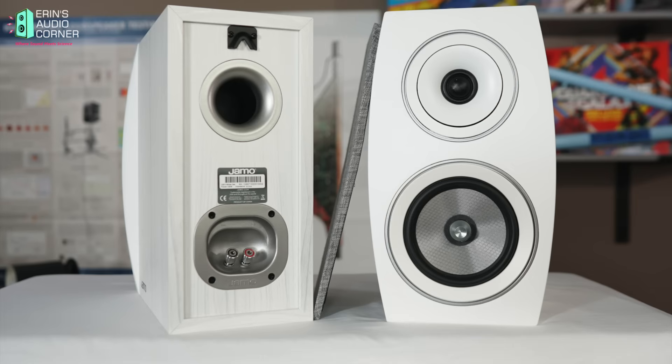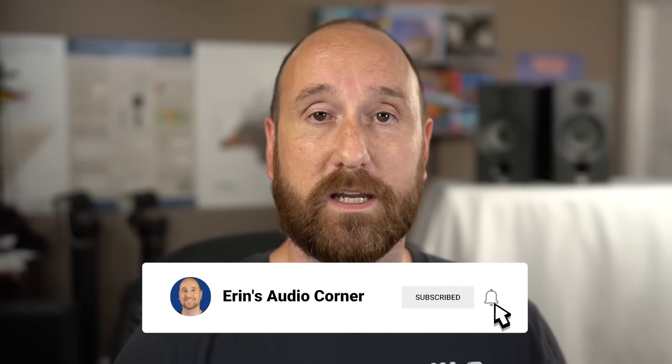The speaker is a good one — I like it — and at $300 per pair it has a really good price. The looks probably leave something to be desired; it's not the flashiest speaker, but normally you pay more for looks, and at this price flashy looks usually mean compromised performance. If I owned these, I'd recommend using EQ to fix the 700 Hz resonance and bring down the 4 to 6 kHz area, and use them with a subwoofer if you want high output levels. Otherwise, run them full range for good kick bass, just don't expect deep bass. Thanks to the patrons — that's how I was able to buy these speakers myself. Thanks for watching.